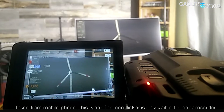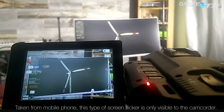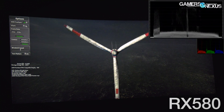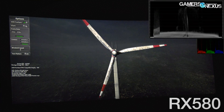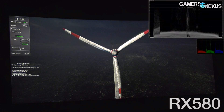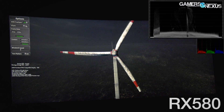Depending on what you're looking at in our footage, you'll see two different kinds of flickering. One type, seen in the B-roll on Vega 56, is a wave-like flicker only detected by the camera — the human eye cannot see it. The other type is an entire screen flicker, where the whole screen goes lighter and then darker or dimmer repeatedly. That's the one you need to be concerned about, and it's what we see on the 500 series. The scopes show both patterns, but they're clearly different.